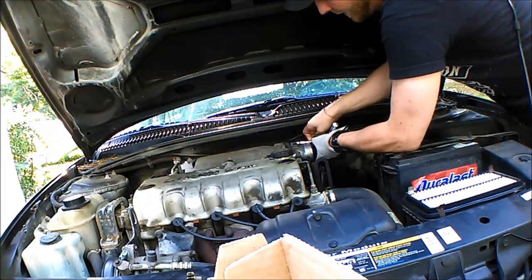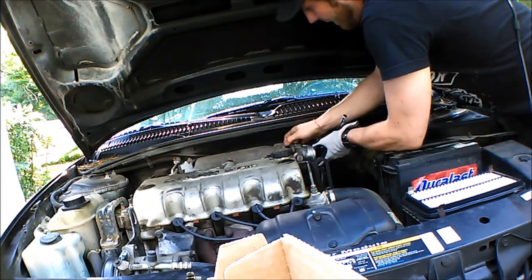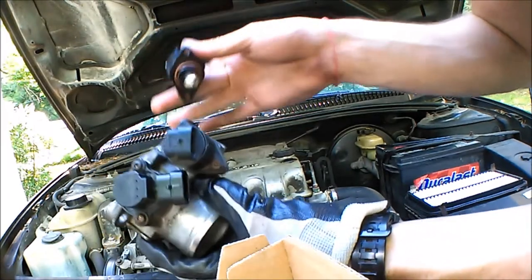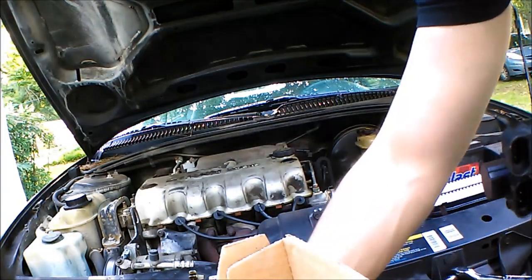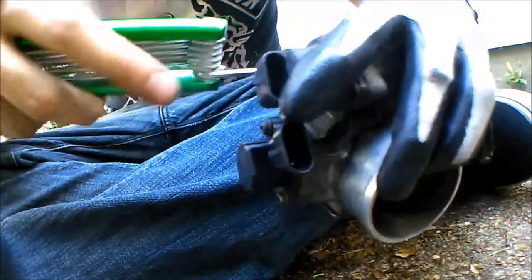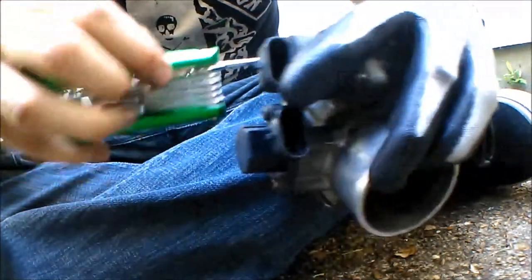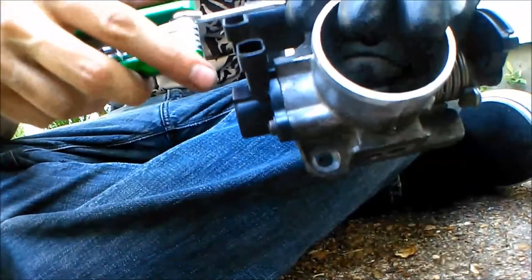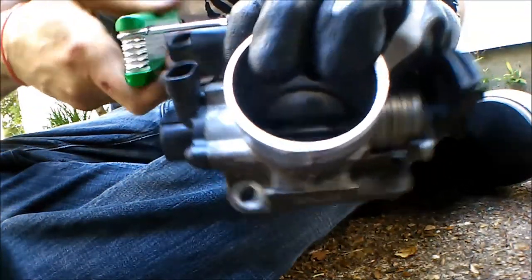So that's what we're going to hope for, and if not, at least you learned something. Alright, looks like we got it — this is the piece we're going to be replacing. Hopefully this little part is down where it's supposed to be, because I don't have the tool required to loosen it back in. These little star hex screws are all over everything on the inside of a Saturn, so it might be a wise investment to buy one of these little handy-dandy sets. Because if you plan on working on anything on a Saturn, you're going to encounter these eventually. Listen to me trying to sound like an expert — but I have worked on enough things on this car to know a little bit.